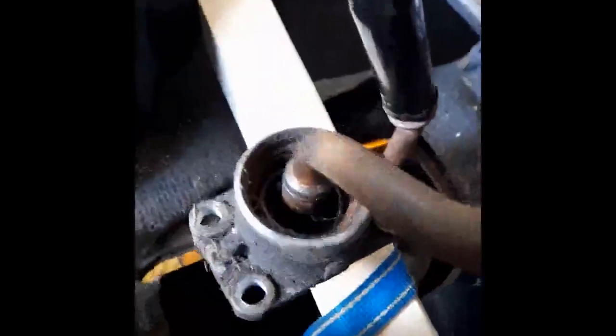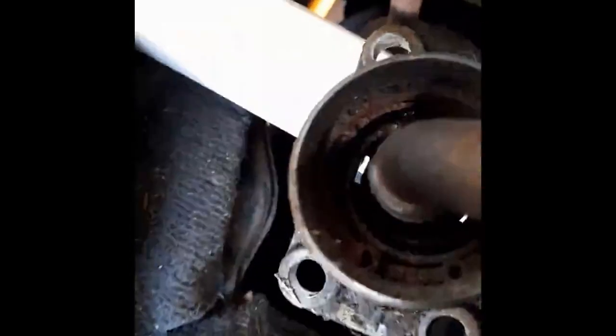It also exposed the top of the four-wheel to two-wheel drive lever, which would sit pretty much straight down there. It's got four bolts on it, and from the aperture in the vehicle you can undo the inner two quite easily, but the two nearer to me you can't undo easily — there's almost no way to get a tool in there. So what we did was drill two holes and use an enlargement tool to make them about one inch in diameter. We can patch them with a little weld later, but it allowed a socket to go down there and undo those two bolts to pull out the shift lever.